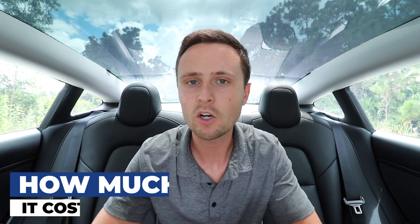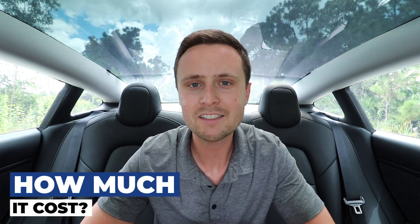Now that we've covered the three main ways to charge a Tesla, let's talk about cost. Both at-home options — the 110 volt and 220 volt outlets — are simply charged to your standard electricity bill. In most states in the United States, electricity costs about 13 cents per kilowatt hour, making home charging by far the cheapest way to charge your Tesla.